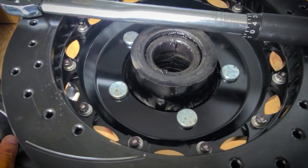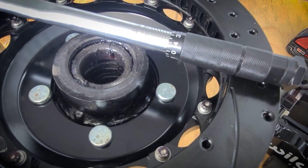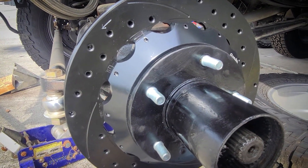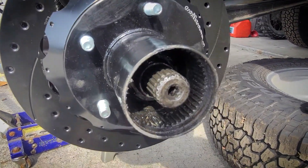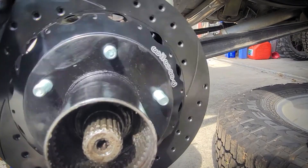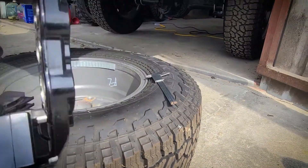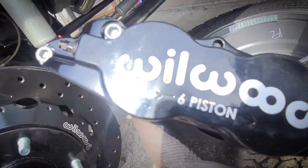Because I am poor and don't have a paint or grease pen, I just color the bolt heads with a Sharpie because I like knowing that I tightened them. Our hub assembly is on. I tightened the bracket bolts behind this rotor down to 40 foot pounds with red Loctite on them, and I have one of the nuts in the hub holding the bearing in. Our rotor is in place. Something I noticed yesterday which is important: rotors are directional also, and I got this backwards. Calipers are directional too — you can see that arrow there.